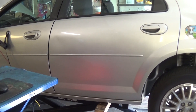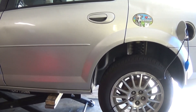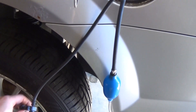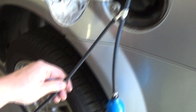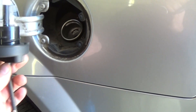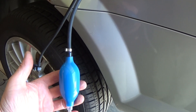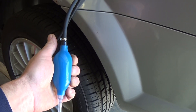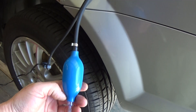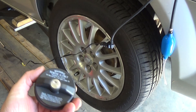In order to test the switch itself, you have to build up vacuum — not pressure, because it's never going to close that way. I'm using a GM fuel tank pressure sensor with a couple of hoses and a Chrysler fuel tank cap. On the other side I have a special pump with an internal valve, so it closes itself — pumping negative pressure and sealing the system. I've also noticed this car has an aftermarket cap, which can be a problem.